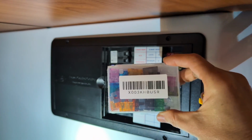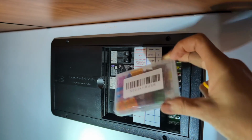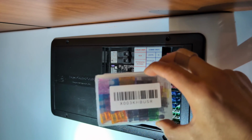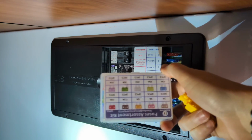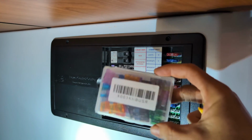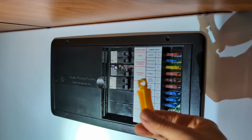I do carry a box of auto fuses with me, which has all the various sizes that are in the trailer. It's really small and compact. I'll link this in the description below, because if a fuse blows when you're on a trip and you don't have a spare, you're kind of SOL. So carrying some auto fuses with you and a fuse puller or a multimeter is a really good choice.